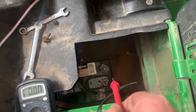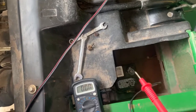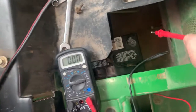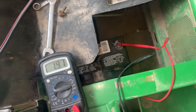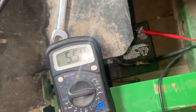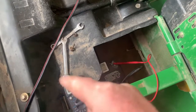With the motor cranked and battery cable disconnected, be careful — if your charging system is a 20-amp system, you'll need to put a DC shunt in so you don't blow your meter. I put my probe on there and at idle we're only putting out about 1.3 amps at 14 volts. I increase the RPMs and just above idle we're pumping out 10 amps really quick, so I don't want to go above idle and risk ruining the meter.